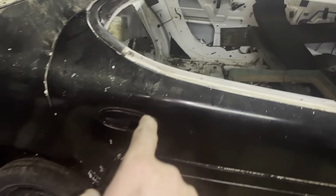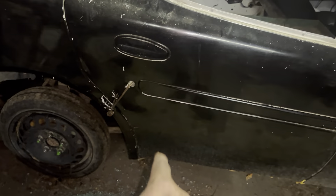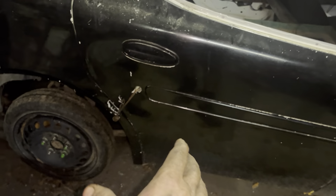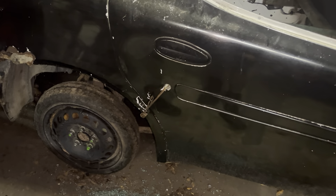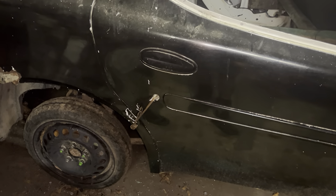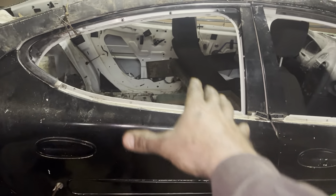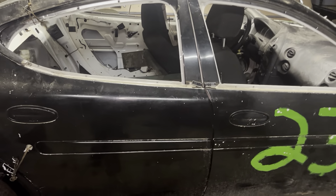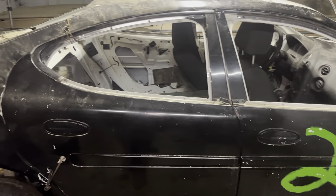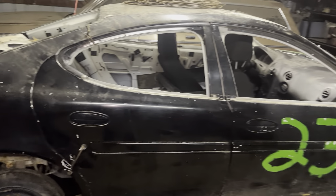This is my back seat bar and I'm going to mount my gas tank right in here. You are allowed to run the factory gas tank if it's in front of the axle — if it's behind it you have to move it. I'm going to move it just because that's one less thing that can go wrong, and frankly I don't really like gas tanks underneath. I'd prefer to have it near me — yes it will be a smaller tank but that's no big deal.